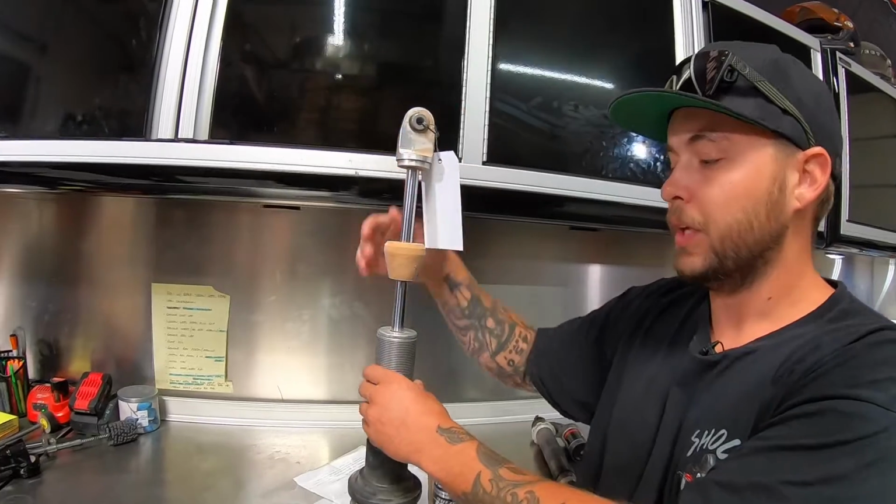Now there's things that you can feel in the car when this happens too. So let's say you got your stuff done, it's all rebuilt, fresh, ready to go. It's been amazing for 2,000 miles. The next trip you go out, you notice the car's starting to feel a little different. You're having to add some compression to it. You're having to kind of play with the adjustments a little bit. The total feel of the car changes. That's a good sign of being internally blown, losing nitrogen, losing oil, stuff like that. So there's some things that you can pay attention to as far as the way the car's feeling too.